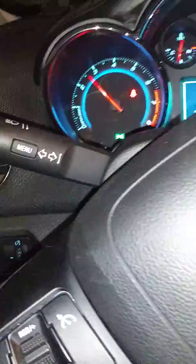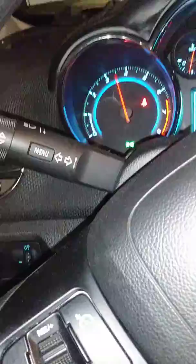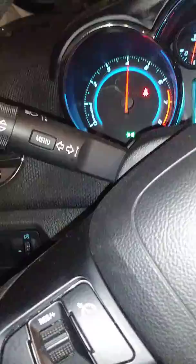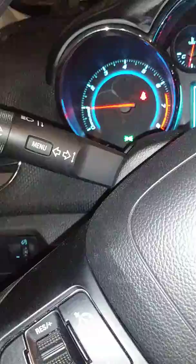She seems to do something a little bit different from prior to the start of this video. The horsepower is there. I'm seeing a resolution. So maybe the computer finally picked up the sensor. But before I call the client and let her know, I'm going to put it back together. I'm going to do this for about another half an hour, see what I get. If the check engine light doesn't come back on and I don't lose horsepower, or get flickering like the battery's going dead, or what you saw in the video early on, I'm going to take it for a test drive and see what I get.